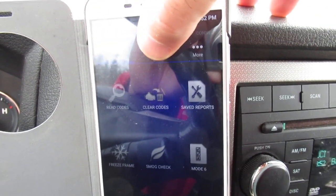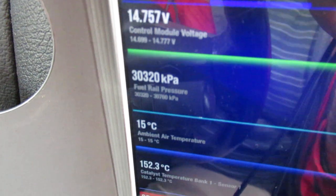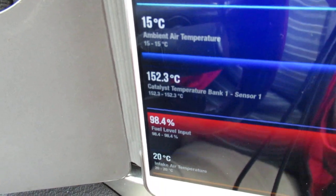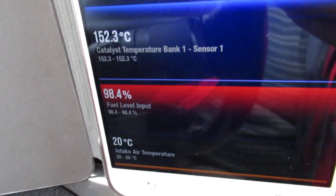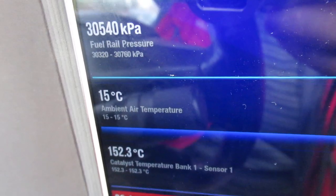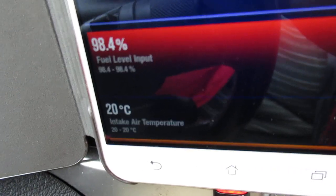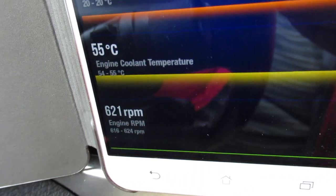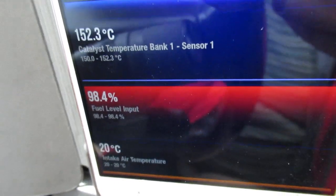Go to Live Data quickly so you can see what's available. I've put in a few different values — you can see fuel rail pressure, battery voltage, ambient air temperature, and fuel level input. Then there's intake air temperature — the 15 is coming from a sensor somewhere under the hood, maybe on the bumper. There's another input for air intake, so you can see our air is five degrees warmer than ambient. Also coolant temperature and RPM to verify that's working.